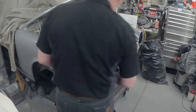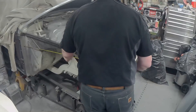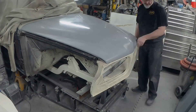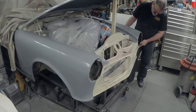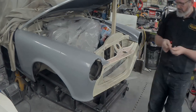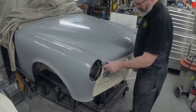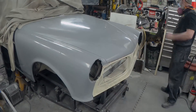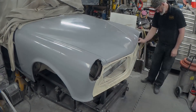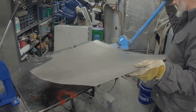Fenders come back out of the rafters and out of the bags and just pushed onto the car real quick. Then I noticed a few things aren't fitting right, so out comes the measurements. That passenger side front corner — the left side as we face the car — is just not fitting properly. There's something really wrong here. This front nose cone section has been in at least one collision. So that's a real problem.